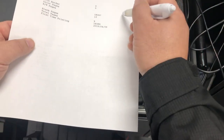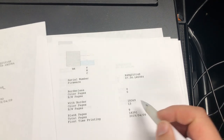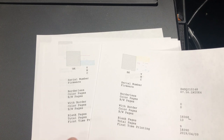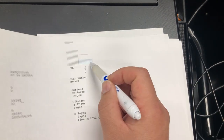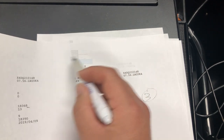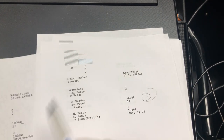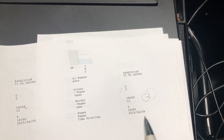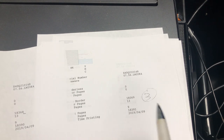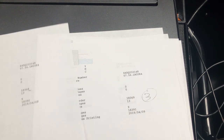You can see this is the first cleaning, second, third. And at the third cleaning, the cyan gets more color, but the yellow is missing again. This is actually a good sign. What I found is if it's really consistent — exactly the same thing all the time — that's not a good thing. So if it comes back and forth, you're more likely to unclog it.